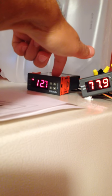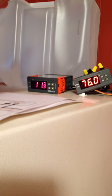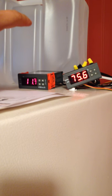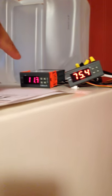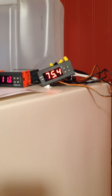If it gets too cold or too hot from what you've set, it'll either turn the heat lamp on if you're using that, or it will turn the refrigeration on. This guy will tackle the humidity first, but essentially it runs a standard humidifier, and the refrigerator essentially plugs right into the STC-1000.